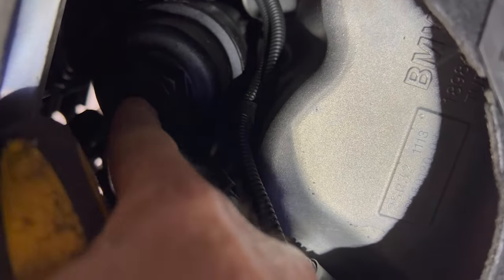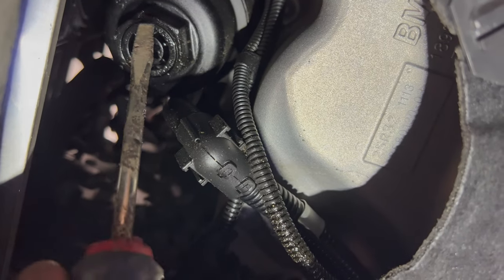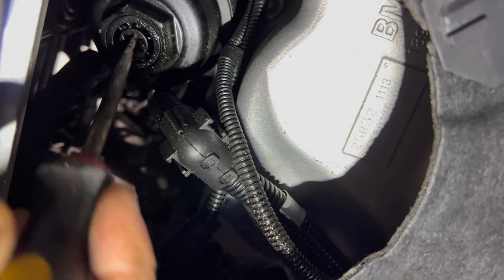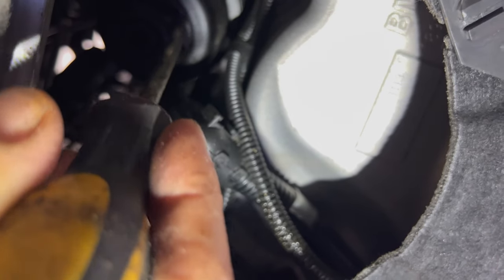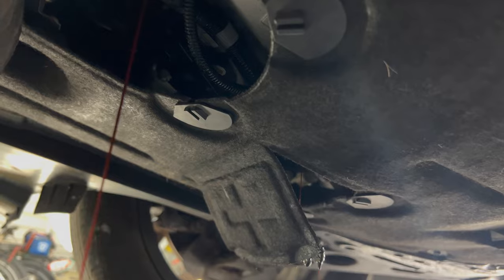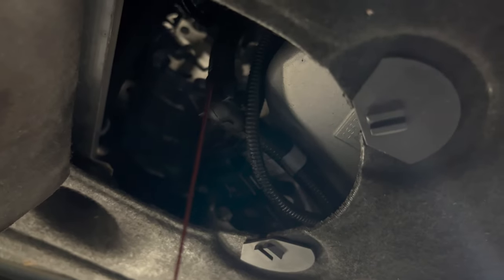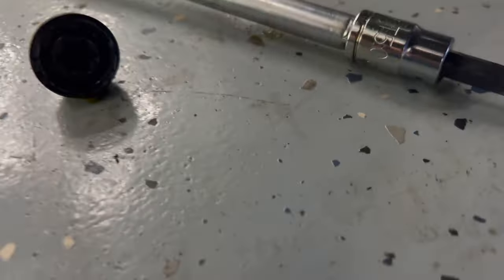Under the front most door is the oil filter. It's canister style. You'll need a Torx 50 to release the drain plug on it. Once it drains out, you put a socket on and take the cap off to change the canister. It's a lot less messy if you pull the drain plug on the oil filter first — first time I just took the whole cap off and it made a mess.